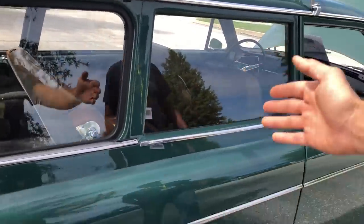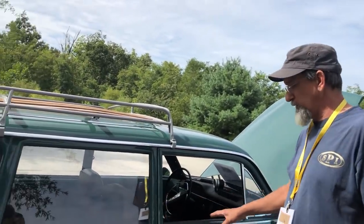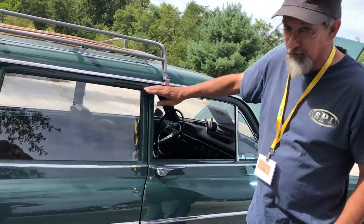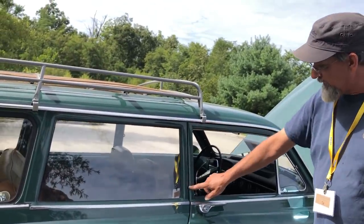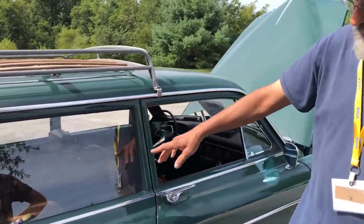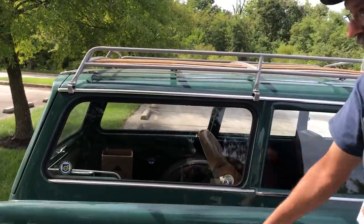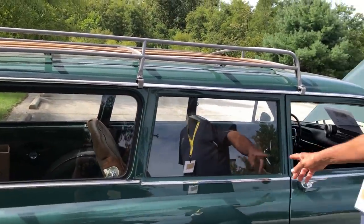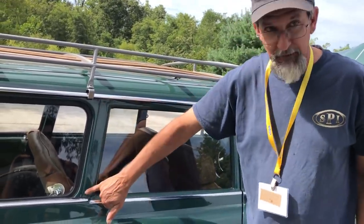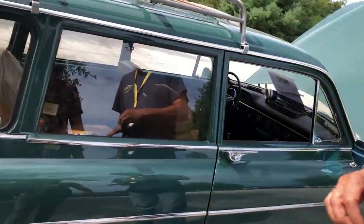So to do this section I've gotten rid of the vertical. The coupe doors and coupe quarters - if you just put a coupe door on, believe it or not, when you put them on this it actually starts to drop down a little, so the gap is off at the roofline. I had to cut this out of the four-door and add it in to make that continue the straightness. It's the coupe quarter back into here, then the coupe door on the lower, but I had to cut this part out of the four-door door to weld in.